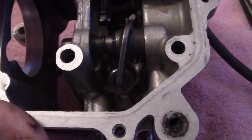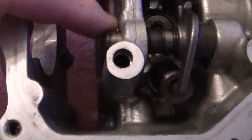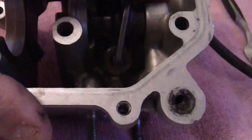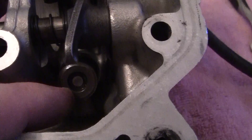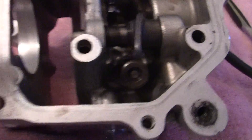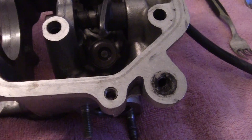The rocker arms float on a pivot shaft right here, which is right here and right here. Now this one is starting to come out — it will come all the way out. There is no pressure on the valves here with the rocker arm, because right inside here is a little tiny stainless steel button. Those come in different widths that will determine your valve rocker arm clearance.